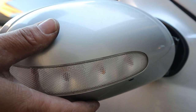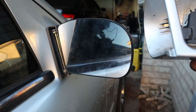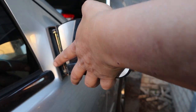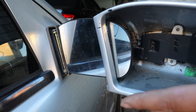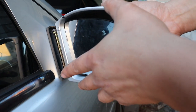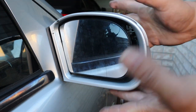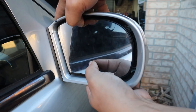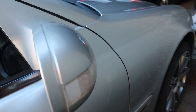Make sure your mirror is adjusted out of the way, then slide the side mirror cover over your mirror without scratching it. Get it in position, line it up all the way around, push it straight in and it will clip back into place. Re-adjust your mirror so it's sitting right. Your side mirror cover is completely re-installed.